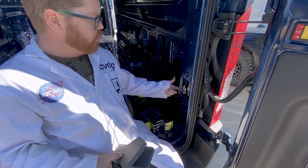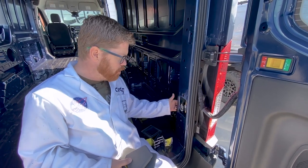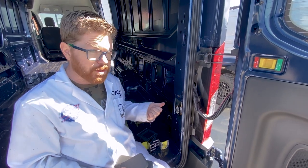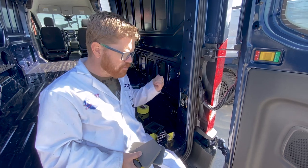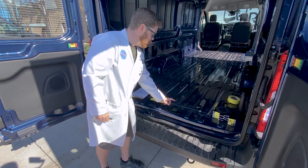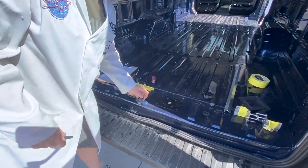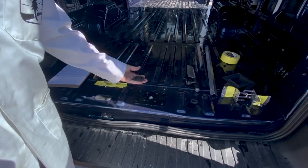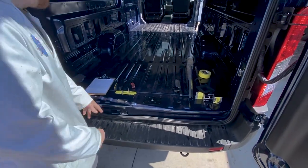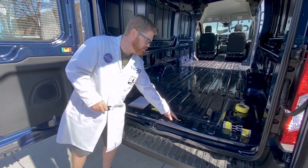There is an option to get a factory 12-volt plug in this spot. If your van has that, go ahead and pop it out — you can upholster over it and put it back in and rewire it. It's tied to the factory harness, so it's not very large gauge wiring and you're not going to run a large accessory off of it. We also want to remove this cover — this is how you drop the spare tire in the vehicle. Before you put your flooring down, I would suggest taking this thing out so you don't accidentally cover it.